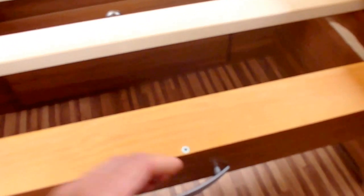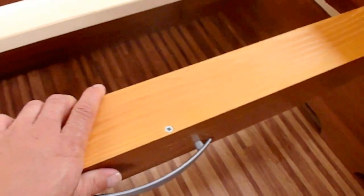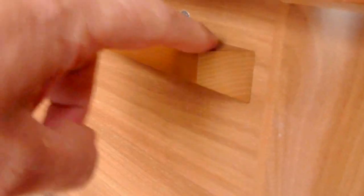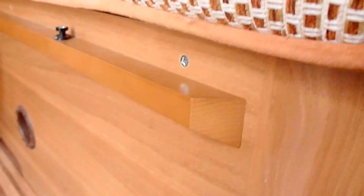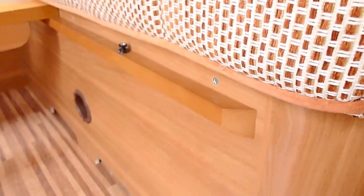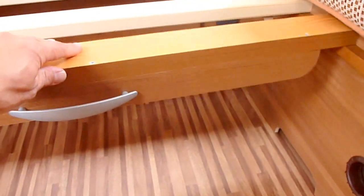To pull the bed out you pull it out with these slats. They are very thick slats so basically they're not going to snap very easily — you often find that where you pull a bed out they're very thin. Also where the bed runs on the ledges here, they're not plastic, they're made out of wood and they're angled down for extra support, so again that helps prevent any sort of breakages there. Very much Adria was designed to use, not just to sell.